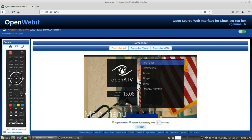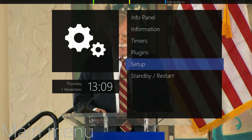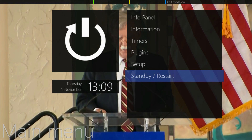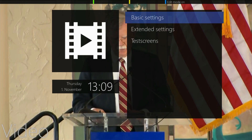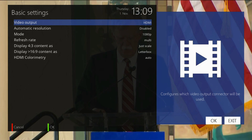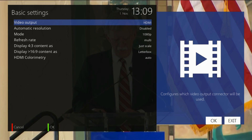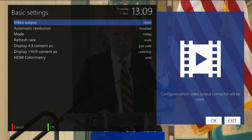What you want to do is go into the setup — just doing a few clicks here. Now I'm going to go through my video settings with you. I've gone through this before but I just want to emphasize this. I ran into the problem where I had 'not supported,' and I quickly discovered that you want to have an HDMI cable that's capable of 1080p and ultra-high-definition connections as well. I didn't have that before, so that's where that problem came from.